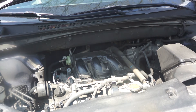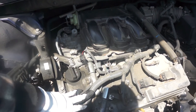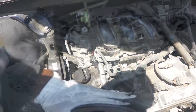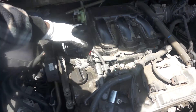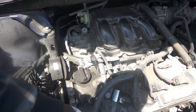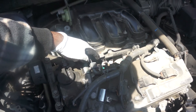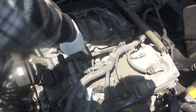This is a 2014 Toyota Highlander with a V6 engine, which means it has two cylinder heads — one at the front and one at the back. The engine is in a V shape. The backside is bank one and the front side is bank two. In the middle of the engine is where the fuel rail is, and that's where you can find the injectors.